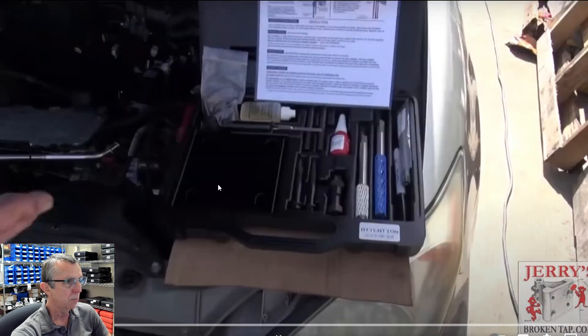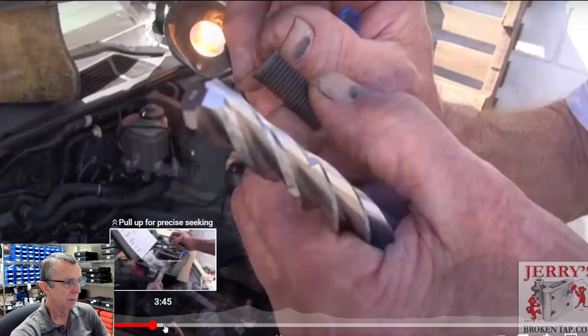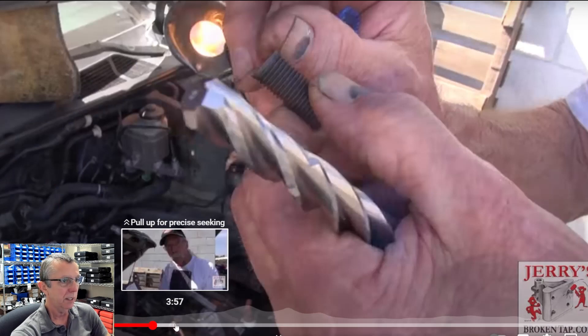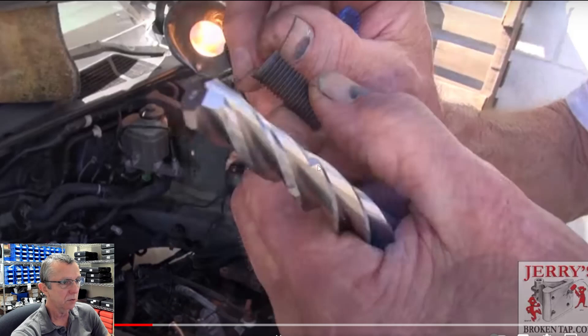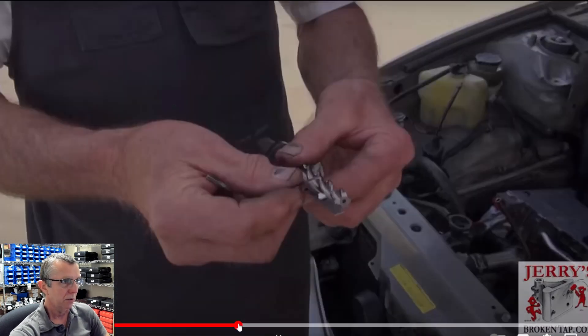Then you take this fixture and that's going to help guide things so that you keep everything straight. The fixture is bolted down and you use a lineup bushing. You measure the depth so you know how far to run the reamer down in the hole. He's demonstrating the 30 millimeter length insert, and you can see the reamer has a little counter bore built into it so it stops the insert at the flare in the proper position.